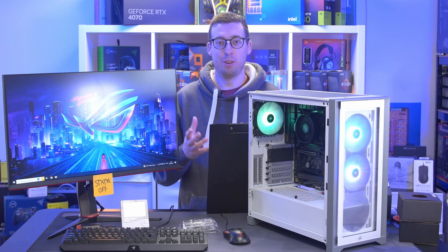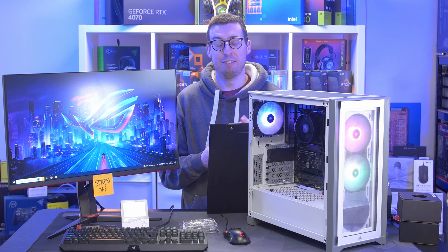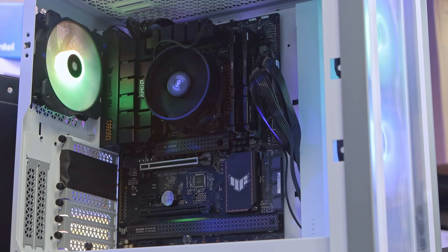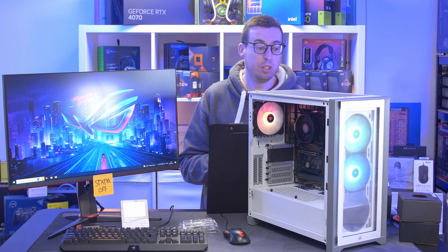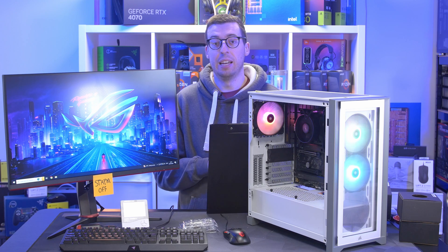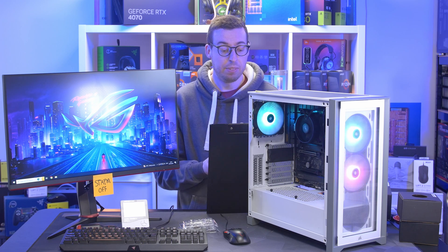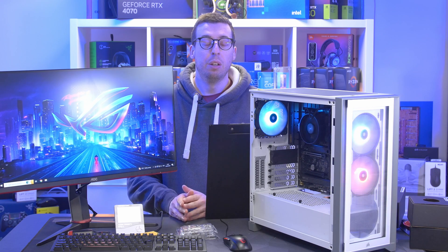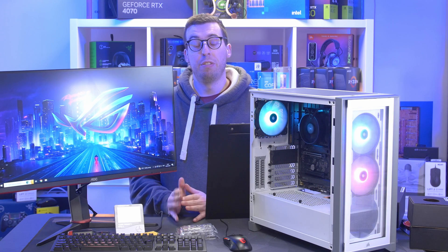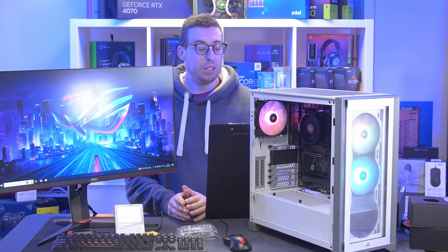I've tested all the CPUs and have a lot to cover. I put all the parts into the Corsair 4000X with all fans at 1600 RPM using fan speed reducers for consistency across thermal tests. I swapped the NVMe to a Seagate FireCuda 530 as the motherboard didn't like the Samsung one, but it's still a recommended drive. I turned STAPM off between each CPU swap as recommended, and enabled DOCP so memory runs at 5200 MT/s.